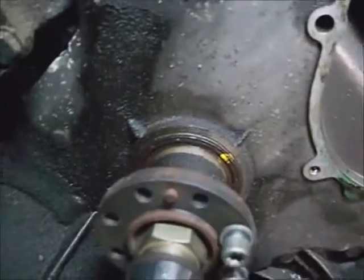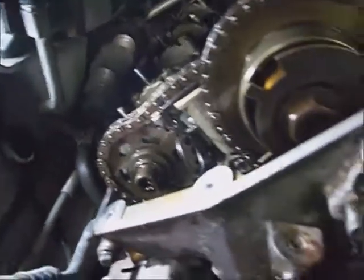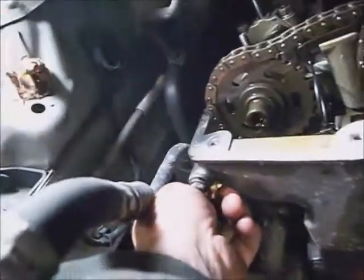I don't know if they're any different or not — do both sides the same. That pin is aligning with that mark. Now take this tensioner plunger out. I went ahead and stuck these secondary tensioner pins in to hold them down, making the chain slack on the secondary chain. A little bit of oil is coming out of it.